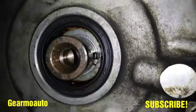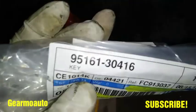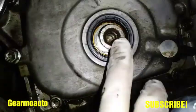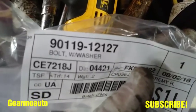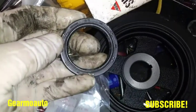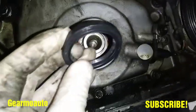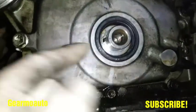Disregard that the seal is in right now — I'm going to show you how to install the seal. You can get a new crankshaft key if yours is messed up. Here's my new seal; it's a Toyota OEM one. Here's the pulley I got from 1a Auto, and I also got a new crank pulley bolt, just in case. I put a little seal glide — a light coat — on my new seal, and this OEM one goes in really easy. I just pushed it with my fingers and worked it around.